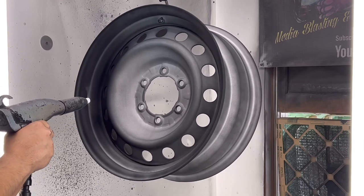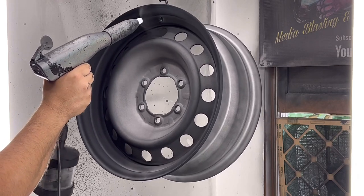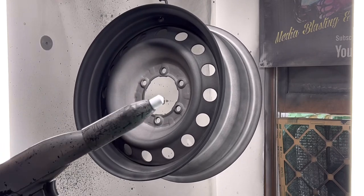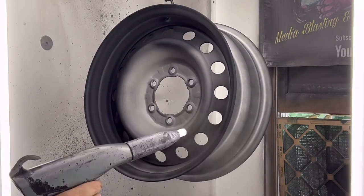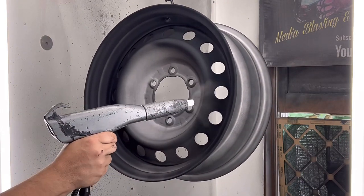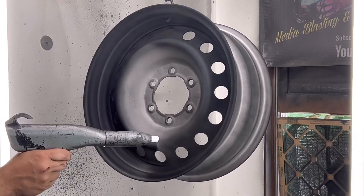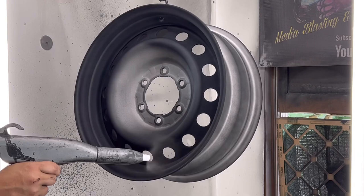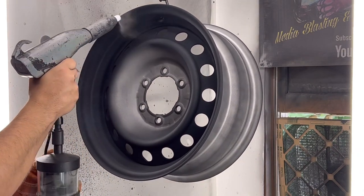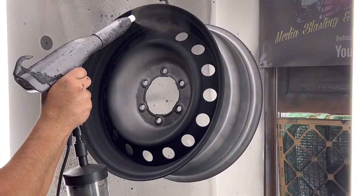in the corner or along that edge so that you don't get too much powder in there, because if you get too much powder, you're screwed. I need a little hair more powder because the wind is blowing. You get too much powder in there, it's gonna run and you're also gonna get bubbles. So you literally have to get just enough powder to cover, but nothing else. So I'm doing my outside, I'm letting it run down a little bit because as it runs out, it loses its power in here. So I'm very high right now, it feels.